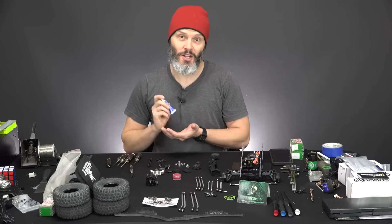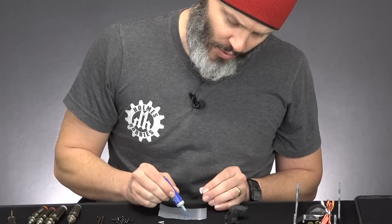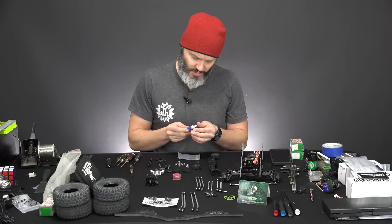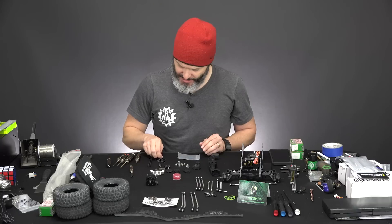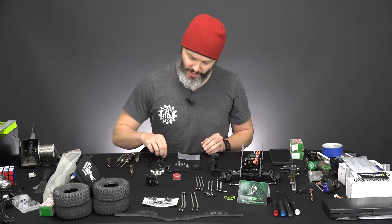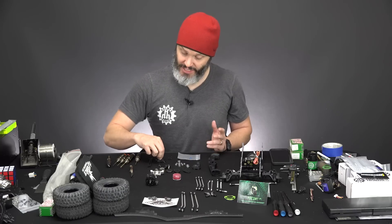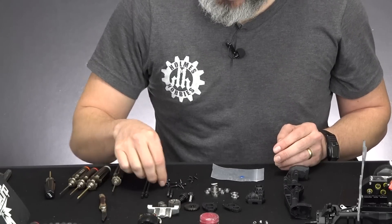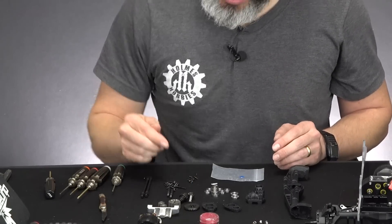The first thing I will start with is the locker. And since I really don't feel like taking the axle apart and putting it back together, I will be using Loctite today. Metal on metal, you always want to use some Loctite — in particular, blue Loctite. You can let it sit out on the table pretty much forever and it won't activate, because the way Loctite works is that it reacts with the free ions in the metal for curing. So if it's not sitting on metal, it basically just won't cure. Ideally we would degrease everything — make sure that our bolts are completely free from grease and that our locker is completely free from grease.